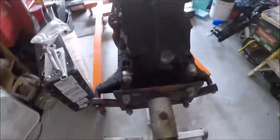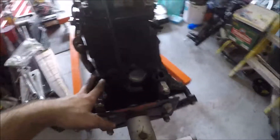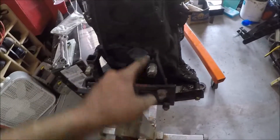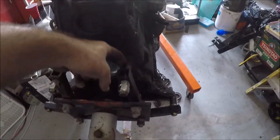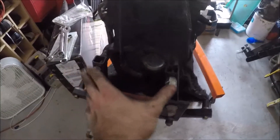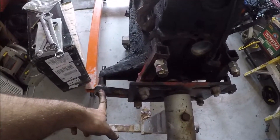I had to buy four bolts for the engine stand. They're the same thread pitch as your bell housing bolts, but they are longer so you can make up for the width of the engine stand. These two are 3/8 and these are 7/16, so I have all those sizes right over here.